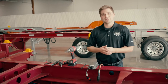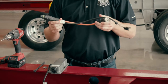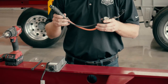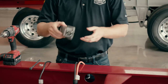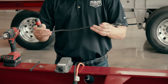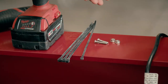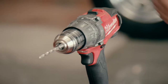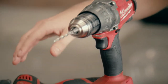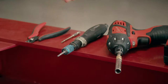First we've got to examine the contents of what comes in the box. You'll notice that you have the ABS jumper, where we're going to tap into the existing harness infrastructure to draw power for the device. Next we have the EZ-Track gateway. The device has its own harness that mates up to the gateway that mates up to the ABS jumper. Four tie straps. Moving to the tools, we've got a cordless drill with a 3/16 inch bit, an impact with a 9 millimeter deep socket, a T25 torque bit, and a set of wire cutters.